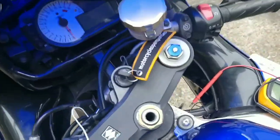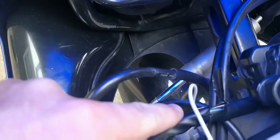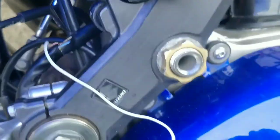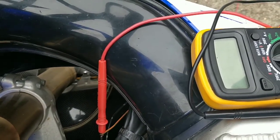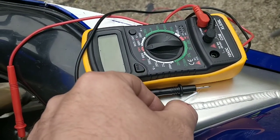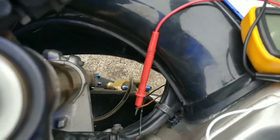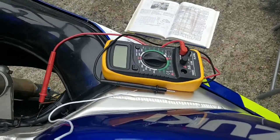So I'm kind of getting sick of filming these things and being wrong, but I found the horn button up here closer to the actual horn itself, in case there's a split between here and further down. I've wired in, sorry about the picture, I've wired in this wire here. I'm now going to connect this wire to the, no, not to the original, to the black one here, to see if we then have our button back. So that's constant 12 volts, but the earth cuts it on and off, I believe. I'm not fully clued up on this, so let's see what happens there.